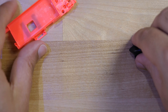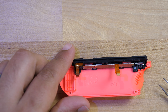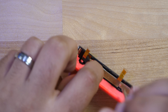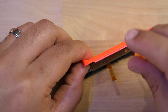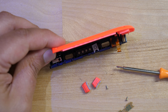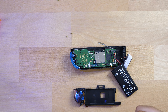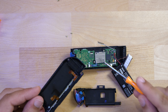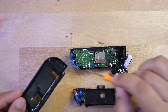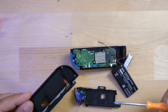The last piece is straightforward — change out the buttons, making sure they're oriented correctly. Now we're going to combine all three pieces: start with the inner piece, put the middle one on top of that, then close the outer shell on top. There are three screws to replace: two here and one on the bottom. This bottom section is the battery tray, and that piece sticks out on the right side as we saw before.